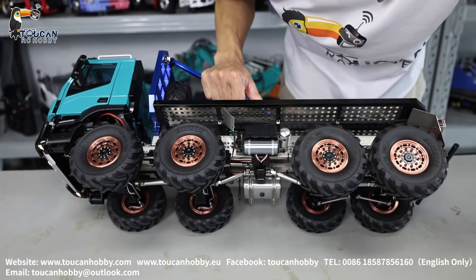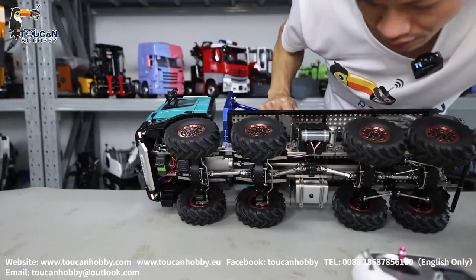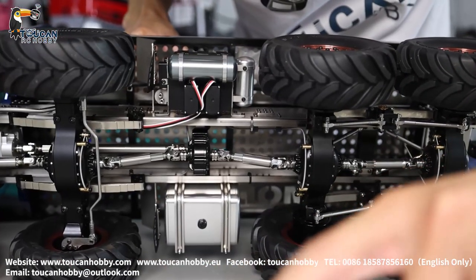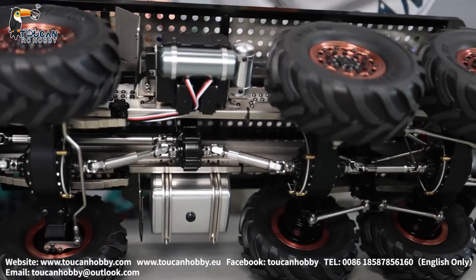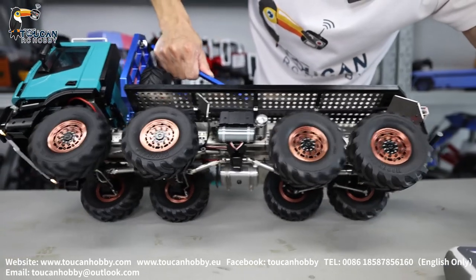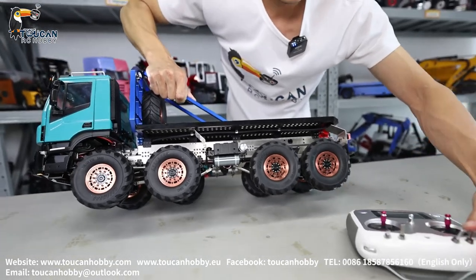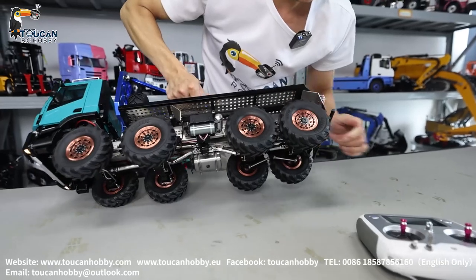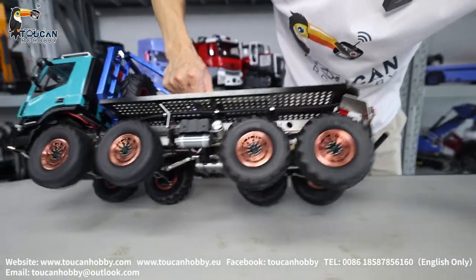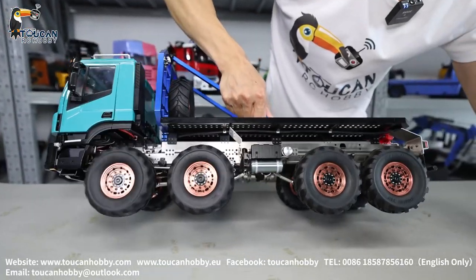This is the differential lock — it is separate. The front two axles lock by one servo; check the wheels, it's locked. And the rear-side differential lock is controlled by one servo. So you can unlock or lock separately. Lock the front — rear side stays at differential, but front side will turn together. Unlock front and lock the rear: front side will be at differential, rear side will be locked. And with all locked, all axles drive together.